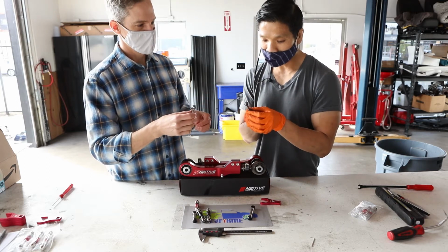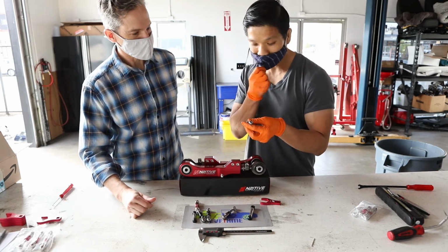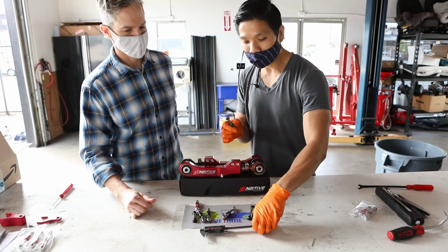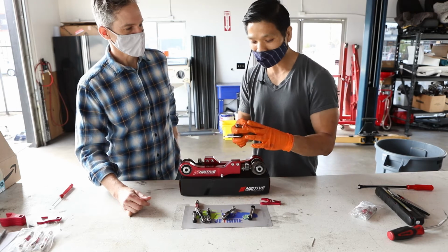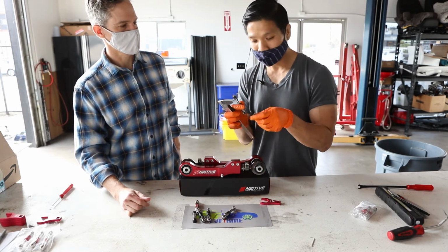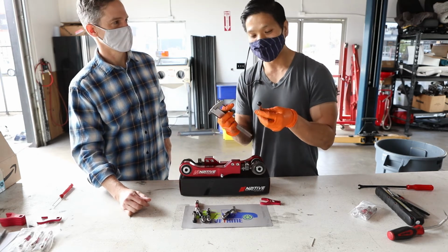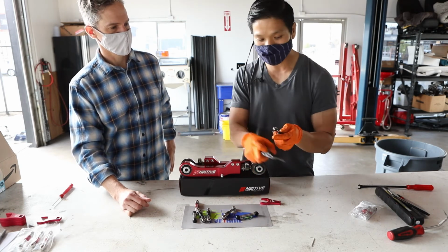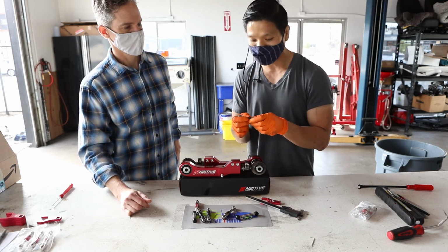I love how you're measuring. You have the measuring millimeters right here, which makes it a lot easier for us to do the adjustments, instead of using a ruler or even a caliper and doing the measurements. Usually we extend about 10 more millimeters from the factory, and with 10 more millimeters, you usually drop it about 1 inch lower. So every 5 millimeters brings about half an inch lower. And with yours, we don't need this. We could just see it, bring it up to 5 millimeters. It depends on what they want. 5 millimeters, they want a sport drop.